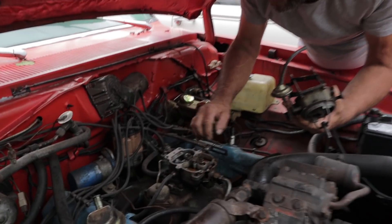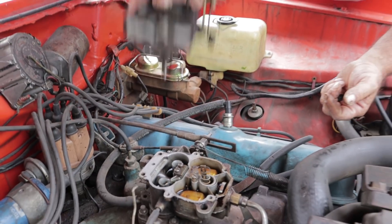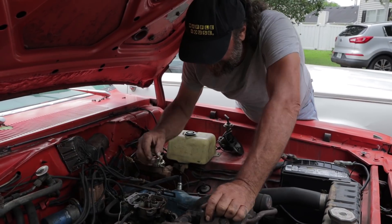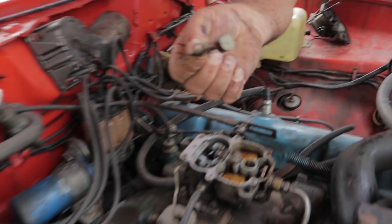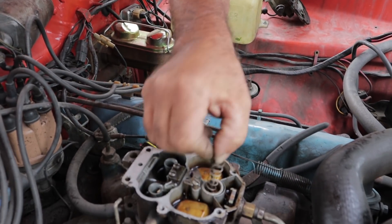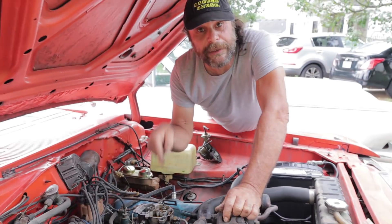And this is what we got — get a look in there. That looks pretty good, doesn't it? Five years, nothing but ten percent ethanol gas. I hear that ethanol kills the accelerator pumps — kills the rubber on them. Let's see. This one is a leather accelerator pump, which should actually be even worse, but no — looks pretty good. Got some pretty good squirt action there too.